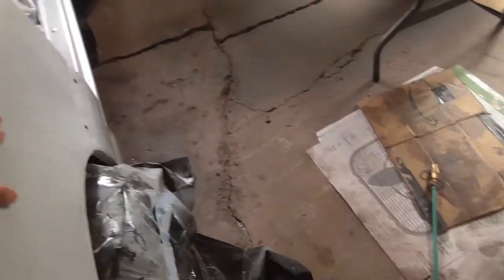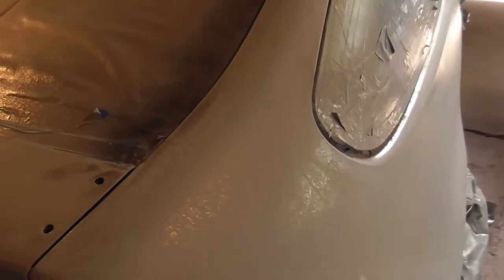If you guys can see, we are done wet sanding everything. These are all smooth, but then it just kind of showed that little water drip. They're not 100% smooth, you guys can see. But Nate said that we could just go and paint it right away, so it should be fine. I mean, we're gonna do more wet sanding anyways after painting, and then after the clear coat. So we're gonna do a lot of wet sanding, and they said it's okay.